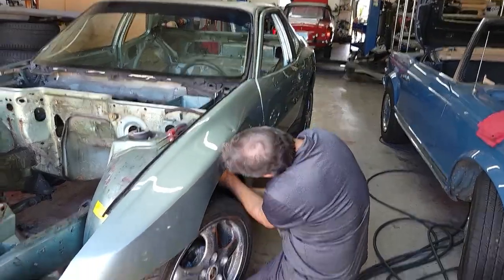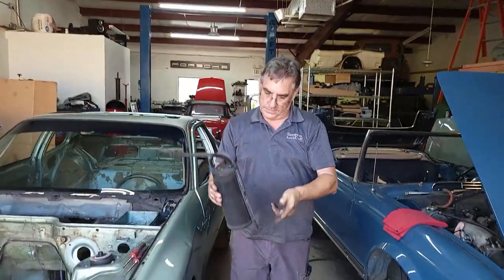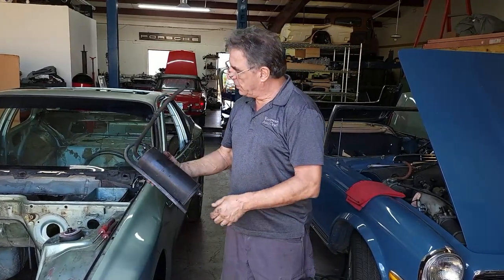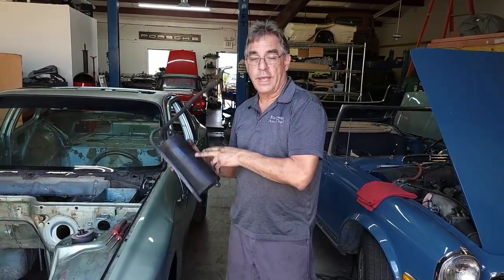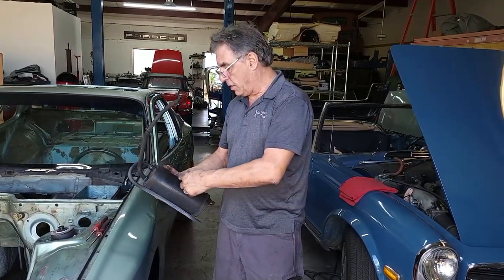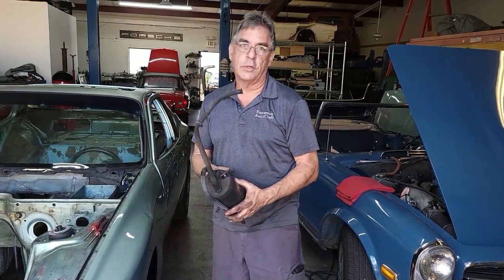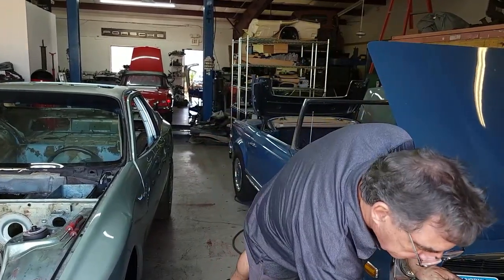This is where fresh air is allowed into the engine to dry out the carbon. When the engine decides it needs a little bit more enrichment, it takes it from the charcoal canister first. When it does open the valve, air comes in here, goes through the charcoal and takes the vapor out. When the engine starts to see that it's leaning out, it turns this off and the computer will increase the signal in the injectors to give it that little bit of fuel it needs. Once this has been depleted you can hear the carbon inside.